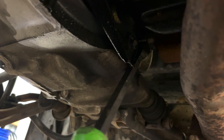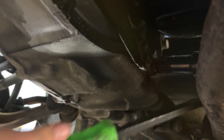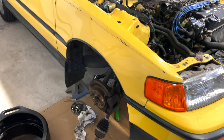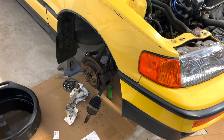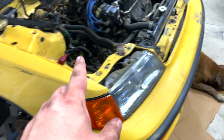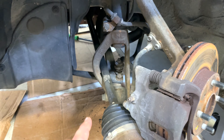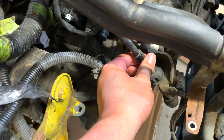See how it popped out. I took the passenger side off — I didn't record it because it's basically the same process as the driver's side. After that I went underneath and popped both axles out. No need to take off the fork if you're not changing the axles — they can just hang out; this fork can remain. Now up top we have to take off this clutch cable.